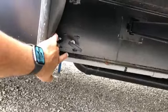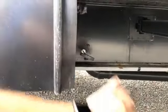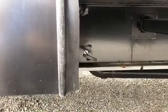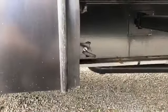I'm going to bring you down here, guys. Bring you to the inside. So we've got our black and gray here. The procedure is that we're going to pull black tank first. Once we're hooked up to the sewer system, pull black tank first. Black's going to start moving the solids out. And then we're going to pull the gray to help usher those solids out, move them out.